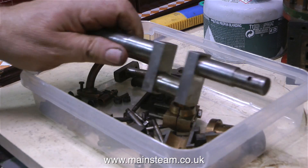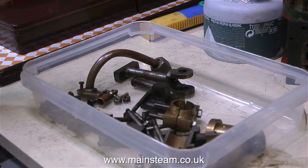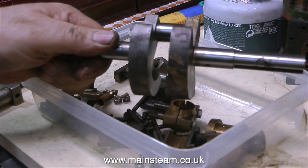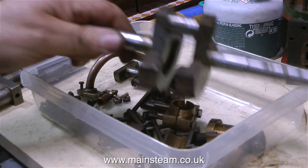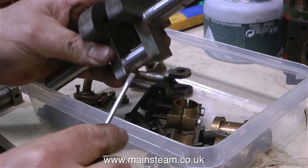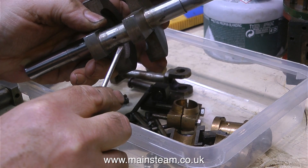I need to have a look at this crankshaft. This is not good - the counterbalance weights are missing, and it looks a bit beaten up. But I have a spare 5A crankshaft, and this is a brand new, machined from the solid, new old stock crankshaft for a 5A. And as well as being beautifully made, this crankshaft has a drilled-in oilway.